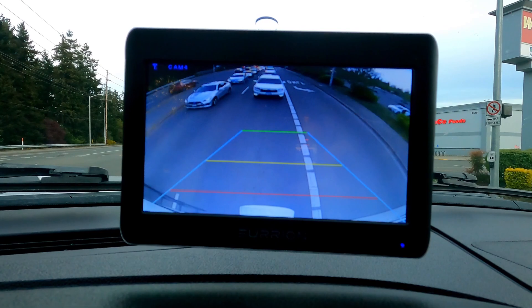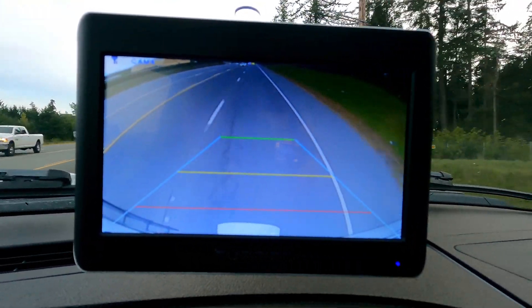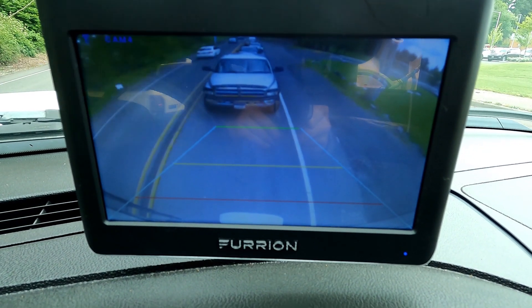I don't know what other camera monitor systems are out on the market. I did a little bit of research before I purchased this one, and this was the one the dealership was going to sell me so I kind of focused on it. The image on the screen is not as high quality as I would expect for the price, but it's adequate. The camera does drop frames — I'll see cars moving beside me or behind me and suddenly they're in a different position. I believe this camera works on a 2.4 GHz wireless network. There is some interference at times and I feel like it's when I'm passing other vehicles that have the same type of camera. The camera will go black for three or four seconds and then come back up — it isn't a big deal and it hasn't failed to come back up, so it hasn't been a problem yet.